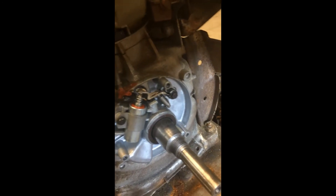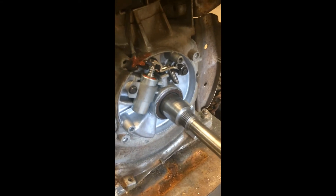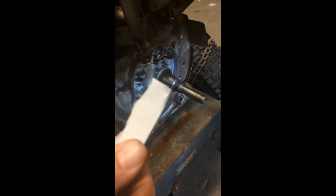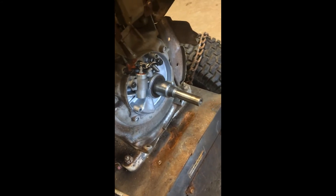Normally what I'll do is open up the points, put a piece of paper in between them, and just clean it to see if we get anything on it. You can just open it up like that, put the paper in, clamp it on there, give it a pull — and then you can see on your paper a little bit of dirt. We'll do that a couple of times until it's clean.